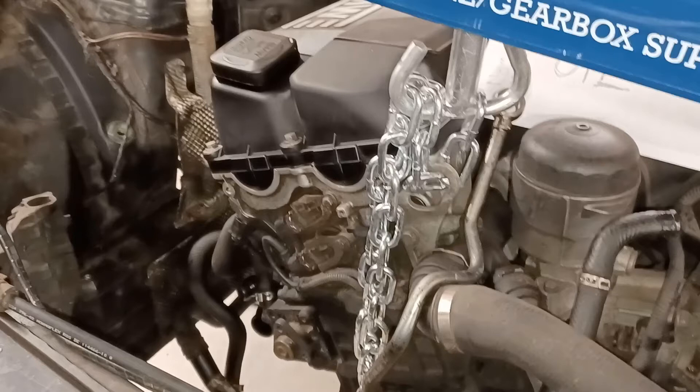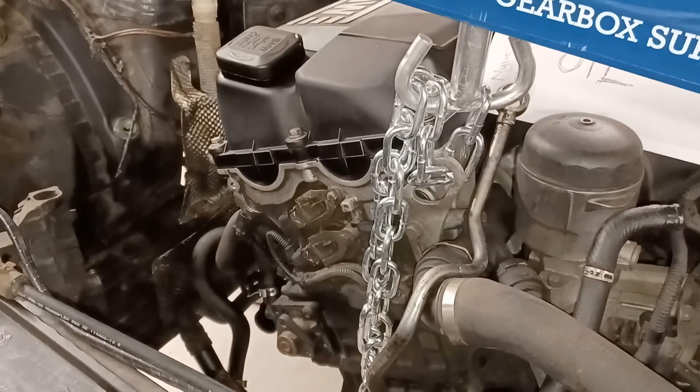At this point I had thought I was just going to stick the oil pickup in, have the baffle done in the sump, and bolt it all together. But Anthony Seddon pointed out that for the sake of £33 for a set of big end shells and a bit more for big end bolts, is it really worth putting it together without doing the big ends? So I've decided I'm going to do the big ends, which is something new for me as I've never done them with the pistons in situ — in the past I've always had the pistons and con rods out and then replaced the shells.